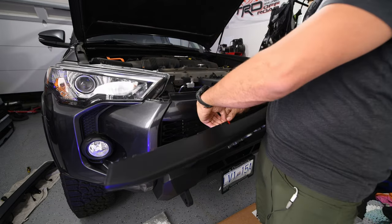Pull the cover off the fuse panel. You'll see fuses rated 15, 7.5, 10, 10, and another 10 — between those two 10-amp fuses there's a gap, and that's where we'll plug in the fuse connector. Come up from underneath and plug it in. That connection is now hooked up.